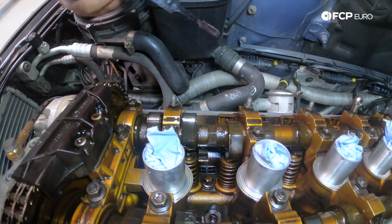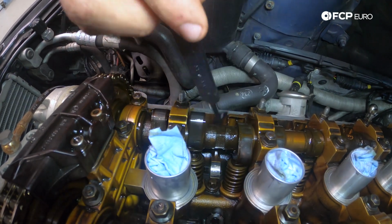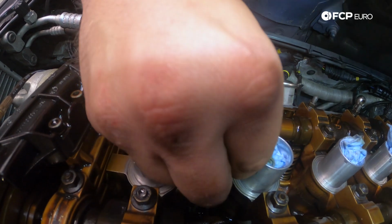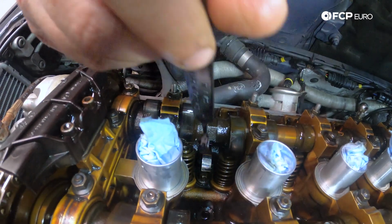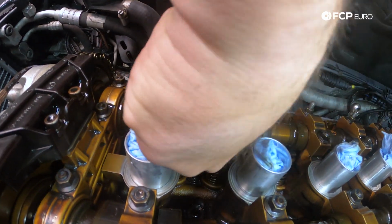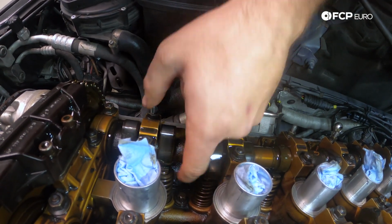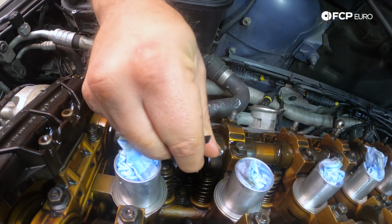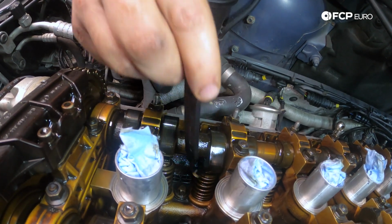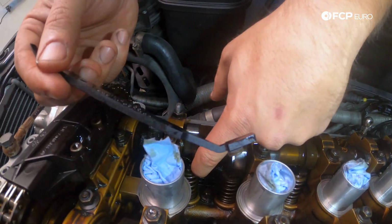And there we go. This is exactly the issue on the exhaust side, it's very easy for the shims to fall out because of the angle of the valve. So you want to make sure that it is really seated in there. Love to say I did that intentionally, but I didn't. And on the same note, later S54s have these really nice plastic covers on the oil return so your shims don't fall in there. So we just saw everything working there as intended.